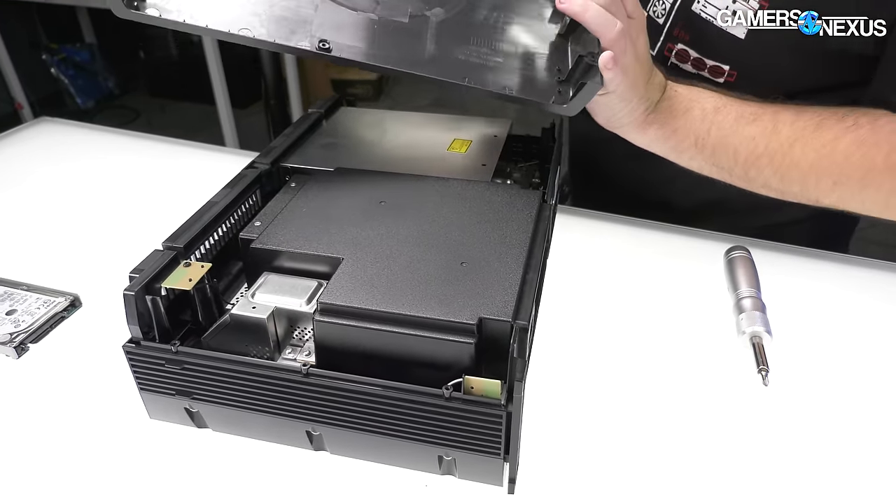Now we've gotten to the super interesting part — it looks kind of like plumbing for the PS4 Pro dev kit. There it is: a giant Nidec fan. They're still using Nidec in the PS5s today, still using giant blower fans. This particular one is fed through a very large vented opening on the back of the device. We'll look more closely at where the air is coming in and which components it's feeding through.